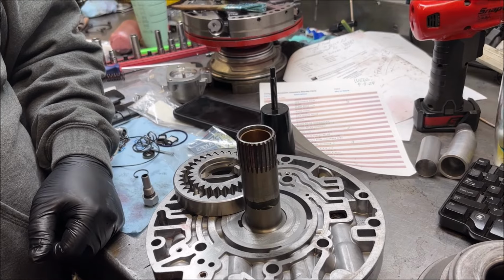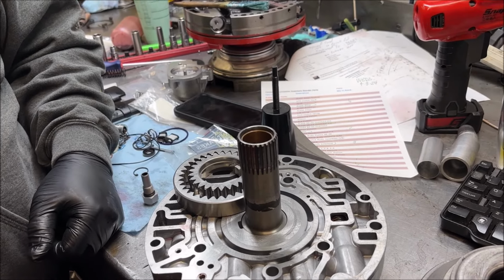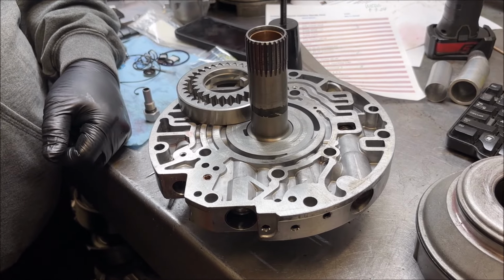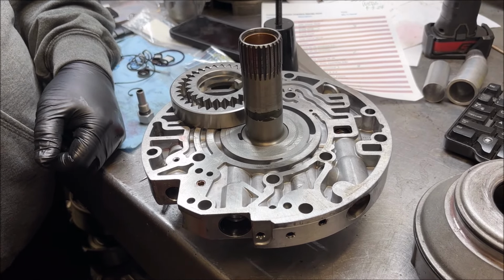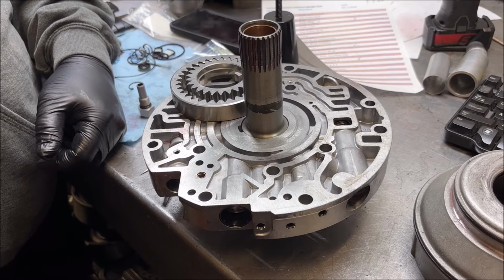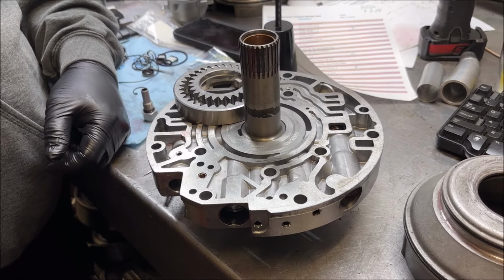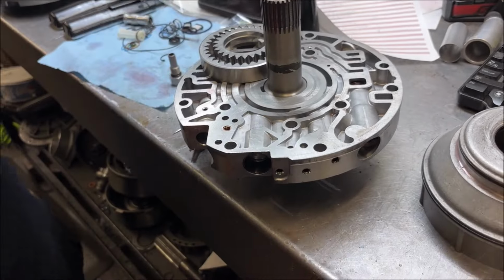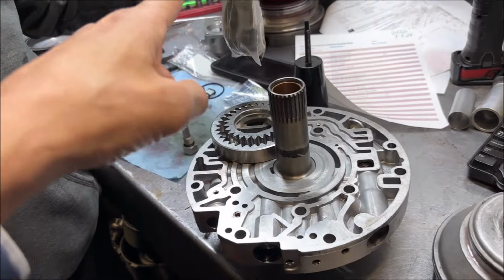So, bellhousing face to torque converter mounting bolts on the converter: 1 inch. And then verify that you've got between an eighth of an inch, or 0.125, to 0.188 clearance. Yeah, maximum is 0.188, not more. That's a pretty narrow range. In racing applications, we try to tighten it up a little bit more than that.